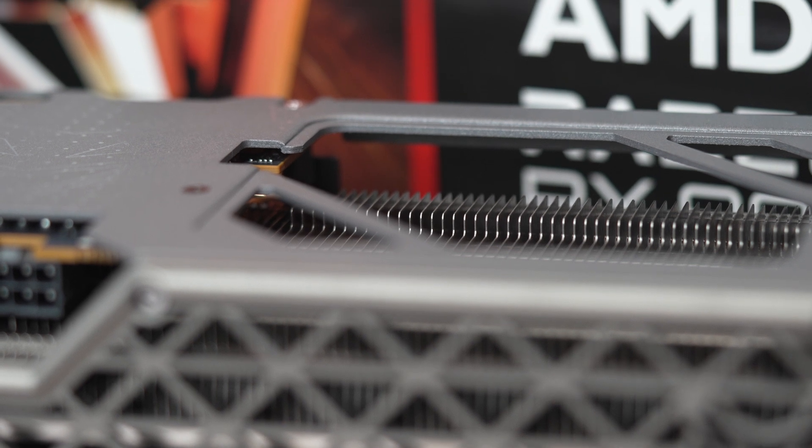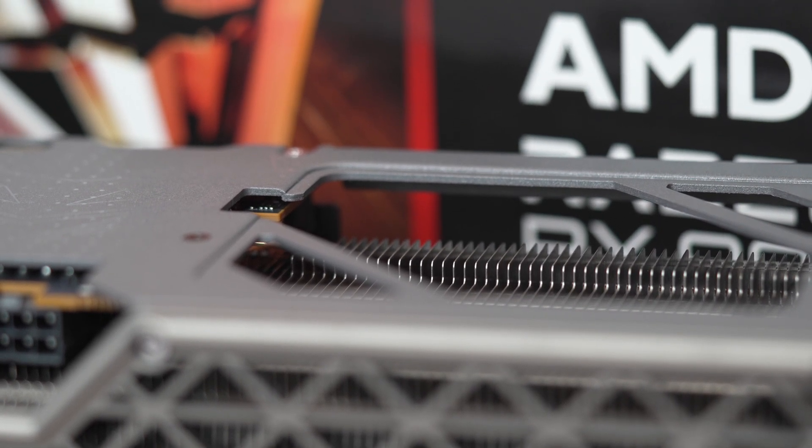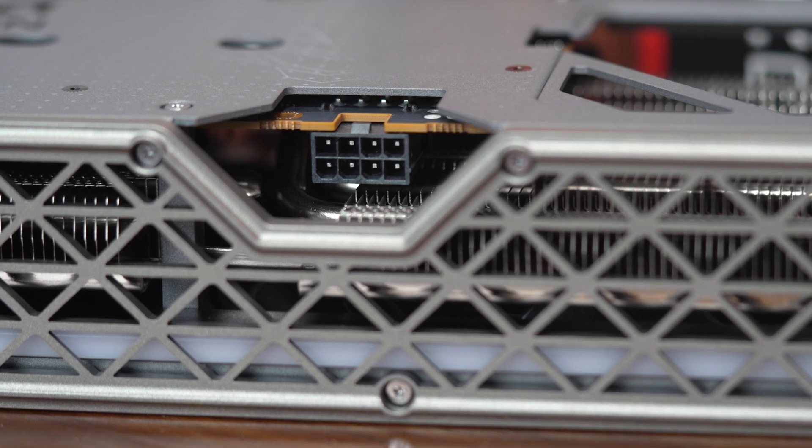Sapphire's Nitro Plus is a very good looking, really premium implementation. The only feedback I have on the design is that it's a big thick shroud, but on the flow-through side the heatsink still has a bit of room below the back plate — so they could make the heat fins a bit thicker there and make full use of the form factor. But you already get very good temps with this cooler, so it's not strictly necessary.